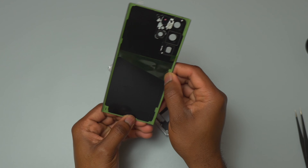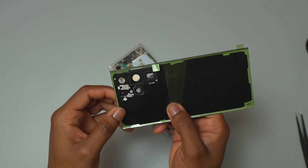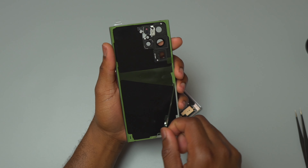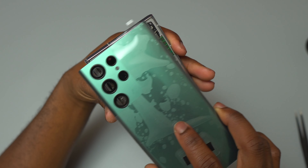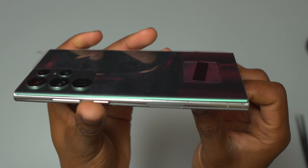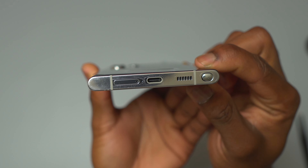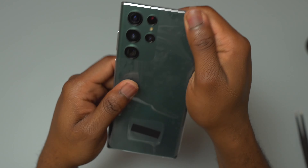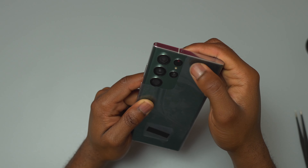For a proper back glass replacement, I have a video in the description for you to check — I didn't cover that in this video because it would be too long. The replacement of the back glass is not difficult; you just need to purchase a good quality back cover. If you did not plan to purchase a new back cover, you can reuse the old back cover if it has not cracked while you remove it to change your cameras. To reseal your old back cover, you will need B7000 — a glue used for smartphone repairs — to seal the back of your device properly instead of reusing the old double-sided tape. If you're installing a new back cover, it is much easier; just follow my videos, I have five or six videos on back cover replacement.